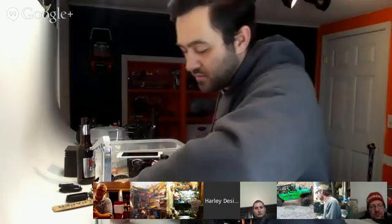Do you think that's because of the C-hubs, or what gives it that? I mean, it was just designed to have that kind of steering. It's just the design of the axle shaft. It's a CVD inner axle, so it's got a lot more operating angle. Everything about that design is definitely made to operate at a sharper angle, as well as the knuckles and the C-hubs, the whole deal.